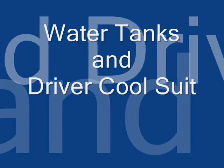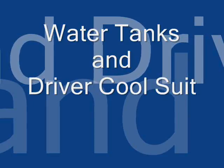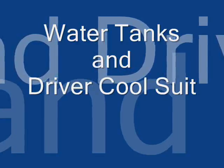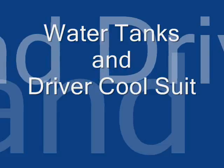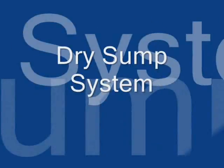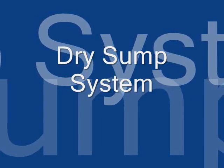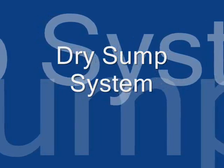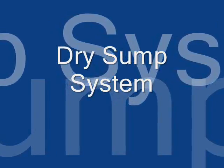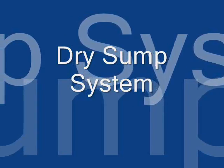We also use the water for ballast — the car has to have some weight, and that weight basically keeps the car on the ground. We have another tank that carries the fuel, and on top of that a tank for oil. We use what's called a dry sump system for this engine, where oil is pumped from the tank to the engine, services it, and is then pumped back into the tank, running through a series of filters to keep it clean.